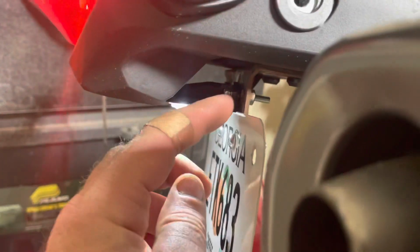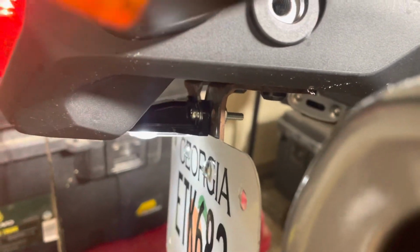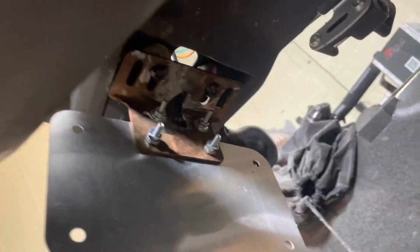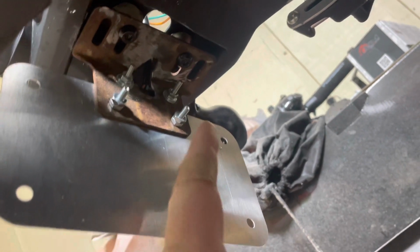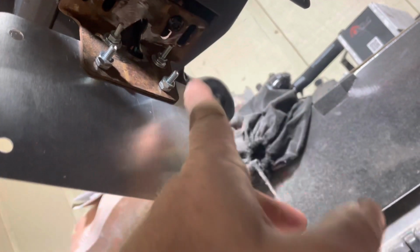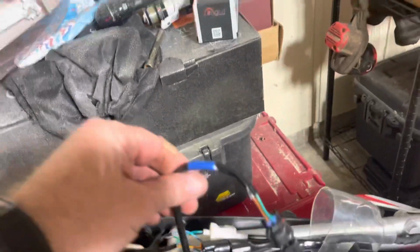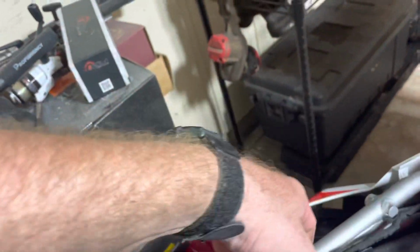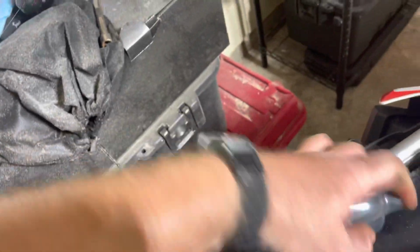I might have to make these and sell these to you guys for about, what, 20 bucks? What, $5 shipping? I could probably ship it for like $2-3. No, I'm kidding. Look at that. That came off of a bed rail. No, perfect. So we had to drill a 5/32 hole here. And of course we had to drill a hole big enough for a bolt to get in the license plate, which isn't going nowhere. And then of course we've got some extra wire here, which we'll just roll and tidy.